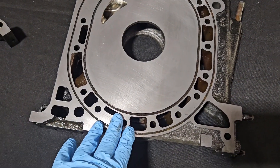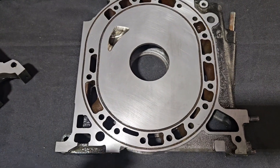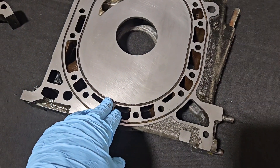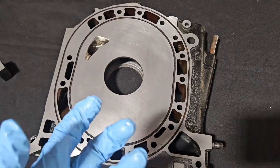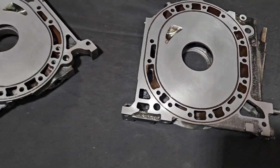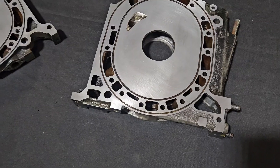We were able to remove all of that corrosion — it came out really nice and really flat. You've now got a good running surface that the seal isn't going to be running over a more porous area that could cause increased wear. Something a lot of people don't think about is if you have one area that starts to wear more aggressively than other areas, the whole plate can end up with an increased wear pattern, and then it's even harder to resurface. If you start to dig into the plate prematurely, maybe the motor is still running with respectable compression, but you could have more internal damage happening because we ignore maintenance items.